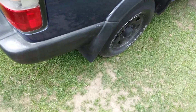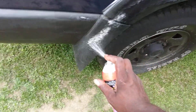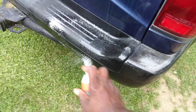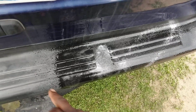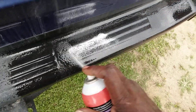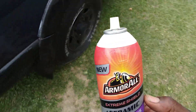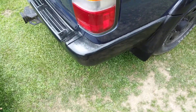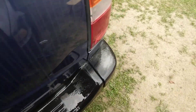So we're going to just hit it here and go around with it. Instead of using an applicator, I'm going to use a microfiber cloth with this. You can see how bad this trim is faded here. This is how it looked at first — very faded. And this is how it looked once I sprayed the stuff on it. Once you spray it, you don't want to let it sit too long because it comes out of the can a little thick. You may have to adjust the spray nozzle on your can.